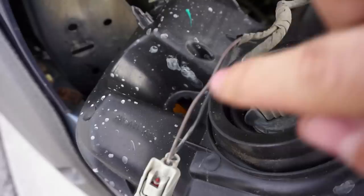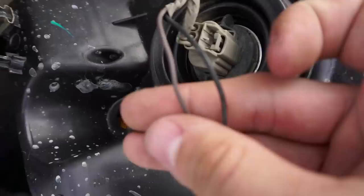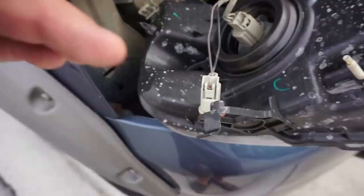I had a lot of tape around these wires right here, but I just used a utility knife to cut a bunch of it back. That way I can expose both of these wires individually. We've got our black one, and this other one - this is what we're going to be splicing our red wire into. The process of doing that, I'm going to be using a quick splice. These are super user-friendly and very hard to mess up. I got them from AutoZone - I think it was like a 12-pack for like $3. Everything that I'm using in today's video is linked in the description below.